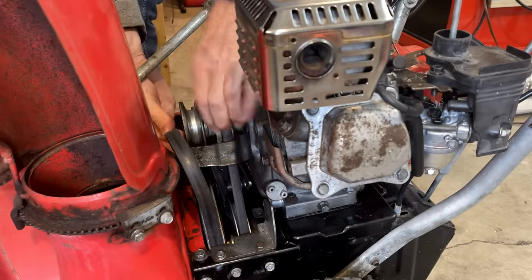So I already pulled the float and the needle out, took a close look at it, and the needle looks fine, but I did find some more debris on it. So I cleaned it off, and just as a double check, I did a pressure test to make sure that needle is holding pressure. You want it to be able to hold at least a few pounds of pressure. I mean, this is gravity fed, so it's not going to be much more than 1 or 2 PSI. But if I hold the float up and pump it up to about 5 PSI,